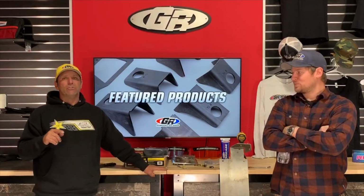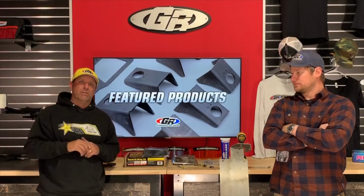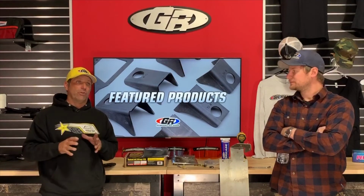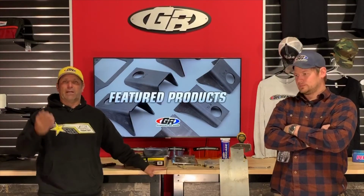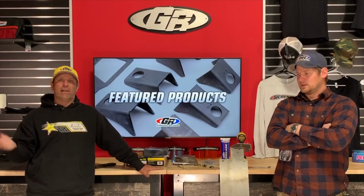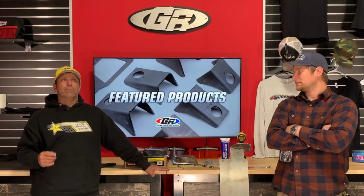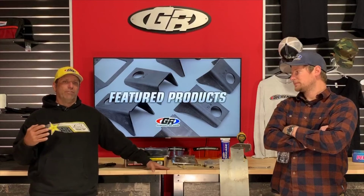In the race cars, we do a Turbo 400 with big LSs. Those are 454 cubic inch LS engines, so they're really big and over 800 horsepower. The built Turbo 400s work perfect behind there. Like I said, we're running a higher stall torque converter with those and an Atlas behind that, and those are very reliable. Again, if you're going to go to an automatic, call, talk to Jeff, talk to myself.